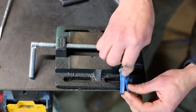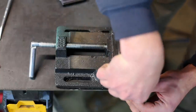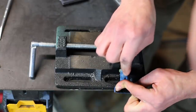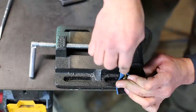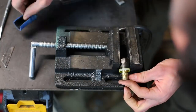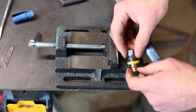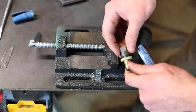I'm going to cut this very carefully and be specifically careful not to score the barbs, because that could cause these to leak. Just to show you how these work — these are push-lock connectors, so you take this hose and you just push it on. The barbs are pretty aggressive so that when you try to pull it off they grab onto the hose really well and prevent you from pulling it off. These can hold about 300 psi.